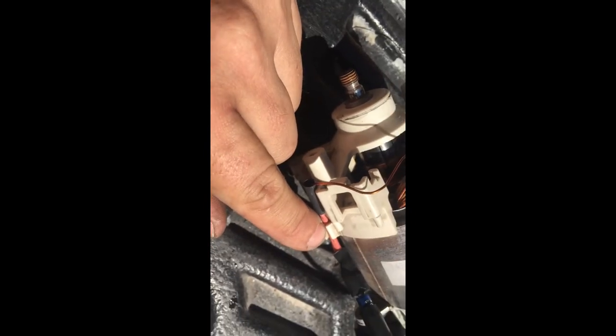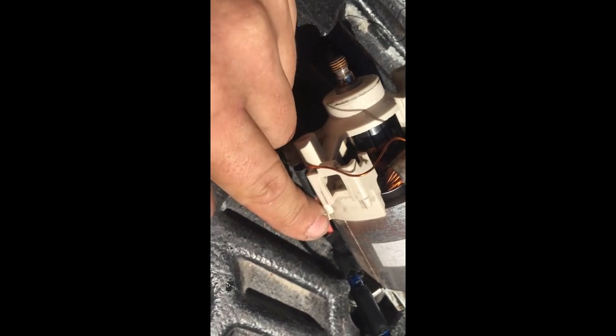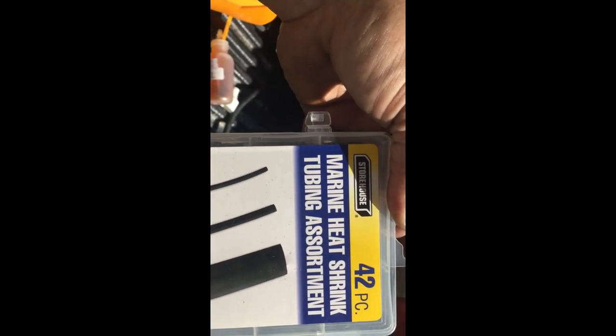The fuse is installed. I sorted the work here, used a little bit of wire so the copper wire holds in place and doesn't flop around. Here's the new thermal fuse, protected by some heat shrink tubing. Sorry for the shaky camera — I'm doing this with one hand. This is now connected before it goes back to the switch. It fits tucked away on the side, still close enough to the engine to absorb the heat, but if this breaks you can simply disconnect it — it's just held together with connectors. Reassemble it and you're back in business.